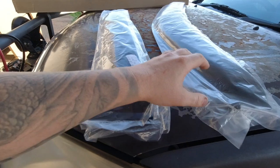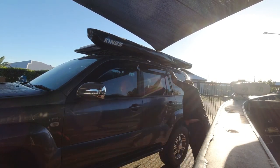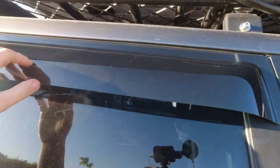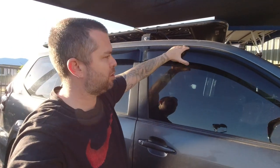Probably the last mod for this video — got a set of wind deflectors, two for the front doors and two for the rear doors. Massive $44.80 on eBay delivered, so can't go wrong. I'll throw a link in the description if you're looking for those. Going to wipe off the mating surfaces with some isopropyl alcohol — it's got 3M tape on the back, just stick them on. They seem to stick on alright, a little bit hard to line up, but tinted, they don't really stand out. It means when the car's parked in the yard I can leave the windows cracked a little bit to let the heat out so it's not getting super hot inside.